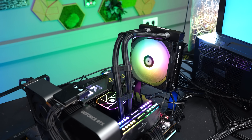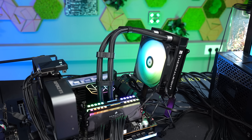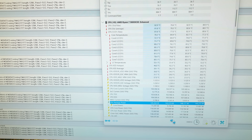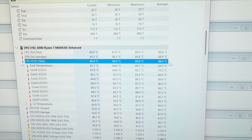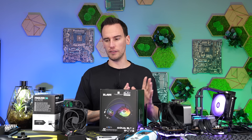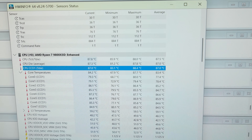It looks actually quite nice, though it might look different in a case — especially a bigger case where a 120 AIO can easily look lost in there. I just started the testing and it will depend how much it heats up. And here we have the result: 88.4 degrees Celsius. This means at least noise-normalized, the 120mm AIO is roughly 3 degrees Celsius worse than the Freezer 36. At 100% fan speed, almost no difference, since the fan was already running at about 80% in BIOS: 87 degrees Celsius.